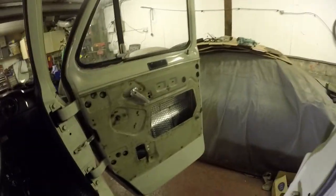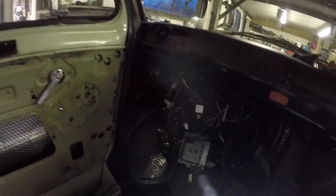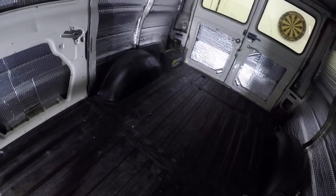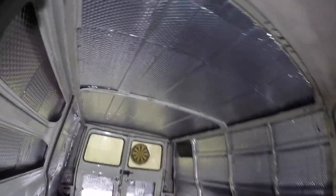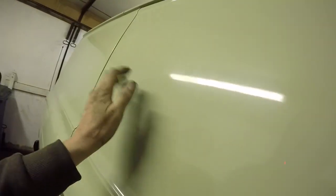I've used all my rolls and pretty much all the pads — it's mostly done apart from a few bits at the back on the roof and sides. Done all inside the doors — not just a few patches, the whole lot. Done the sides, most of the roof, just got to get the headlining down to do underneath there so I'll need to order more. Done all the back doors and the side door. Still got to do the floor in the expensive black stuff — about one and a half boxes left, might be close. Makes a hell of a difference — quietens it right down. Well chuffed. It's expensive but it's worth doing.